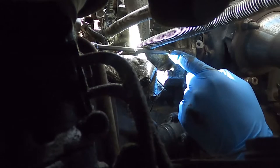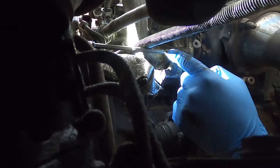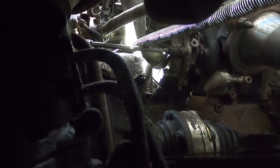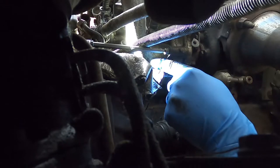There's a small single bolt — that 5mm Allen — that holds the turbo inlet pipe to the turbo itself. You can see it here, and this is why I said you need that longer Allen driver, preferably the ball end. If you have one like that, you can go from above. If you don't, you've got to go from underneath because there's not really a way to go from above unless you have that longer bit to give you the reach.